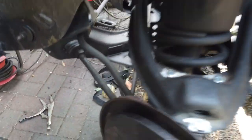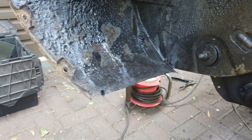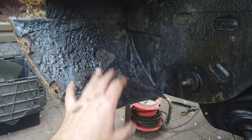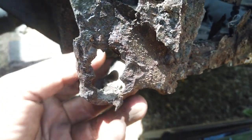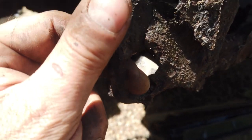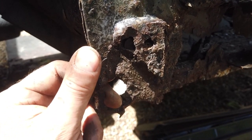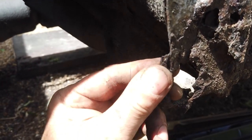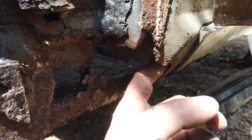Wing is off. Damage report: front valance good - you can see where extreme heat's caused the bitumen to slide, but that's okay. Inner wing - all fine. Wheel well - good. Jacking point - gone. Smashed through. You could just about save that - you'd have to extract it off its spot welds, but probably better off attacking it from the back. You could at least use it as a template. We've been here before with these jacking points - Mad Mike made some good ones. Bottom of the A-panel gone, same as the other side but slightly less.